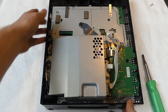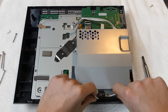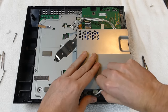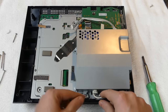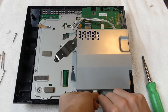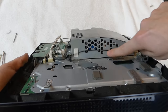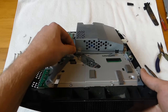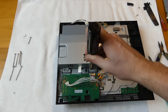Next you're going to take this component off. You can unplug the plug from the unit itself - it unplugs very simply. There are screws around it: three on one side, two on the other side. One screw is under this white cable. To undo that plug, slide it out of the way, press down on the little clip, and it pulls right out. On the side of the console there's a white piece of tape and a black cord running along the unit - take the tape off. Then just unscrew those screws and it's that simple.